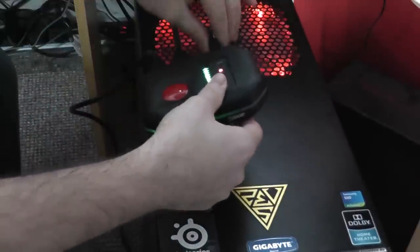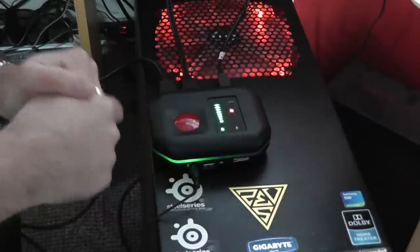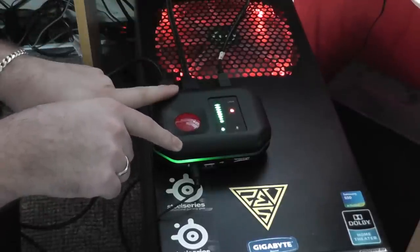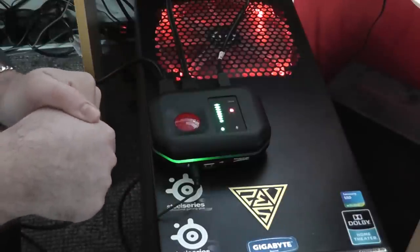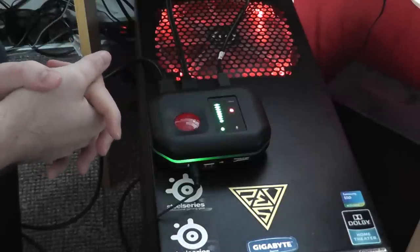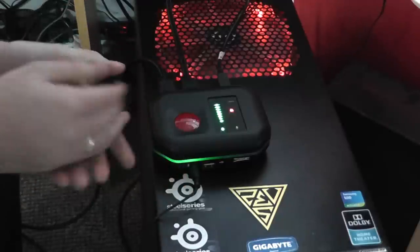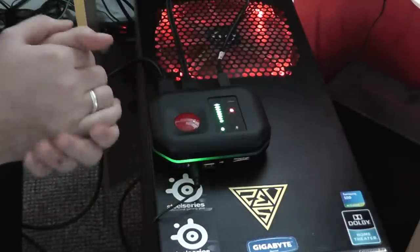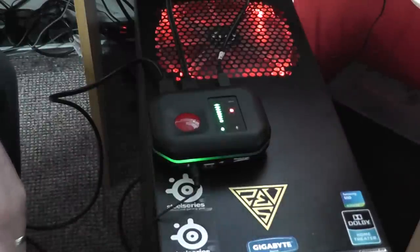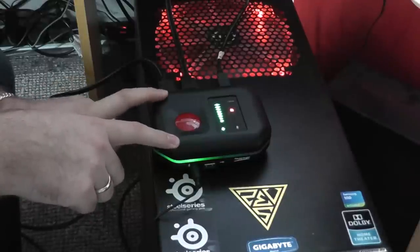Everything's plugged in — that's all you need to start recording. However, with PC you won't actually be able to hear the audio while you record unless you add some extra cables, because the audio comes in via HDMI and goes out to your monitor, and most monitors don't have an audio out.